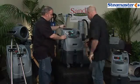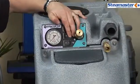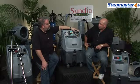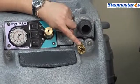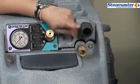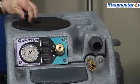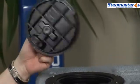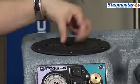It is light, and it is very convenient. Your vacuum motors are independently switched, and so is your pump motor. They're set up to accept standard 1.5-inch hoses, which are available, as well as a 1/4-inch supply line, for your standard American brass. So you know it's top quality, built to last. Your access port for your recovery tank is actually from the boat industry. Tried and true, unbreakable. And they just go right back in, and with a quick clutch, you're done. Super simple.